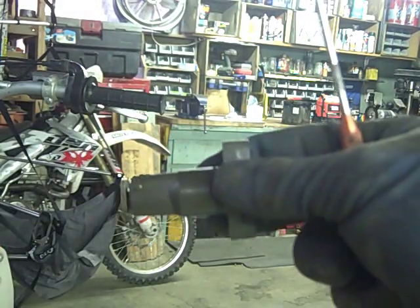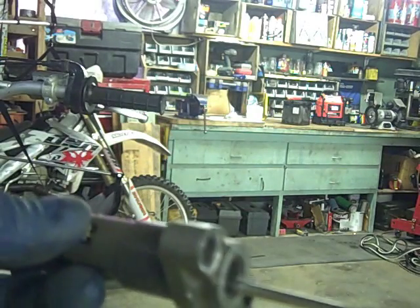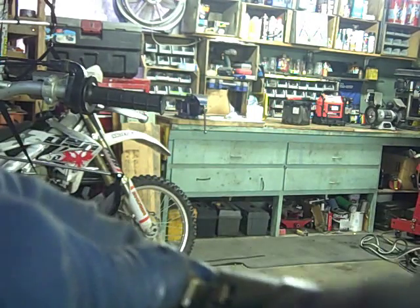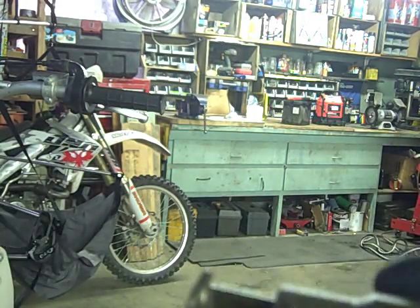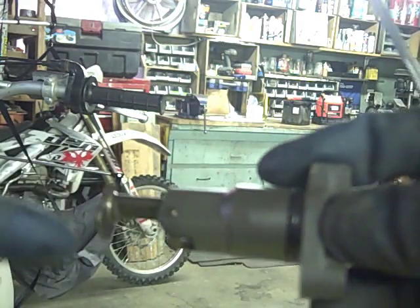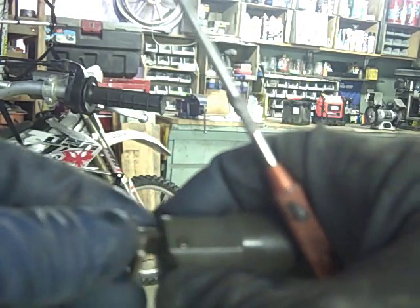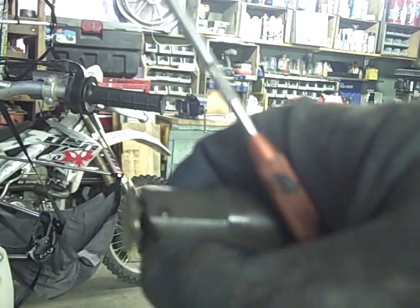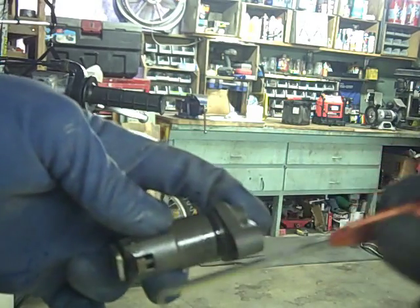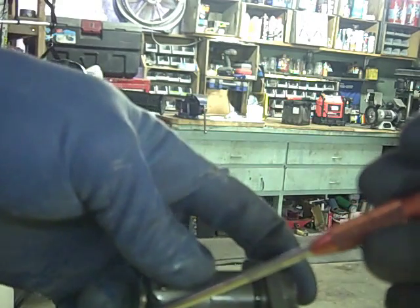This is just detail about how the tensioner works. I'm not a huge fan of this one — instead of using a screwdriver from the back, there's a spring that goes in here with a cap nut. It is ratcheting, which I think is necessary. If you look down at the top where the timing chain goes in, it sticks out to the left side of the bike. The way that it's relieved is you pull down on that little nub. If you have a dental tool, you can reach down in there without having to take it out and push on it with the dental tool.